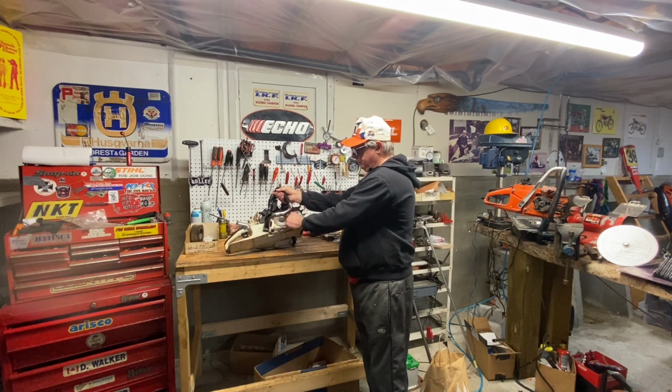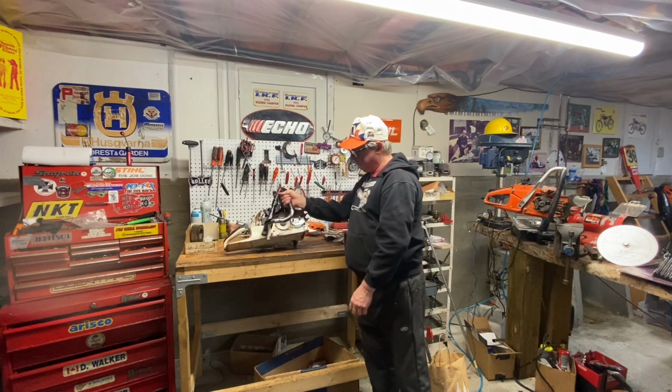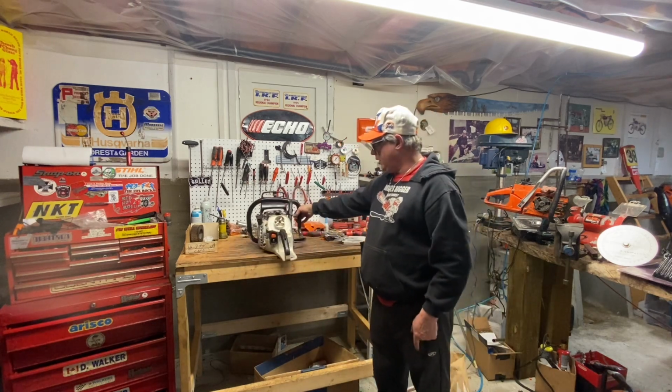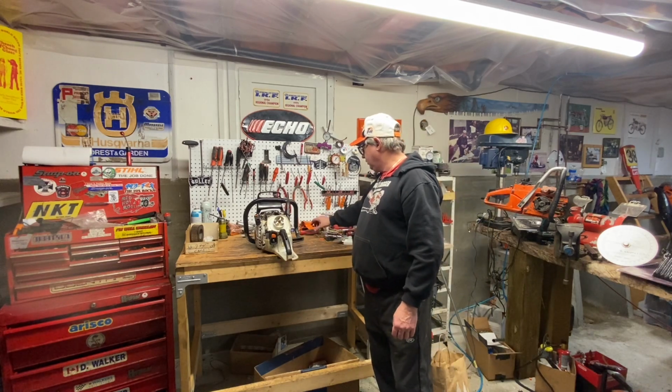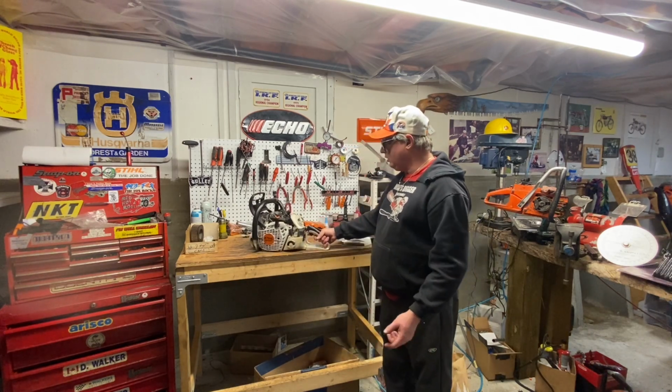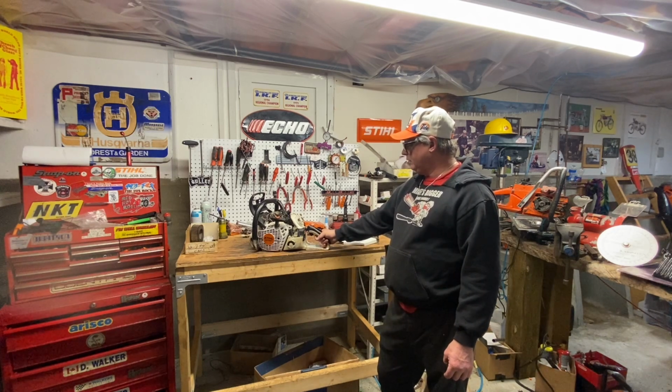It's a maintenance thing. I talked about that to a guy on Facebook the other day, but I've done videos of that too, where a person needs to take this clip off, this drum off, clean inside here, and re-grease your bearing and put it back together, and then you can inspect everything properly. So it's just basic stuff that, if you're making a living with something like this, you really should be doing. It doesn't take that long. It's like 15 minutes at night, man. It's half an episode of Friends or something.